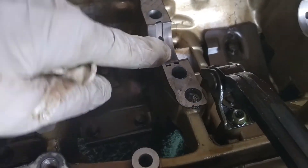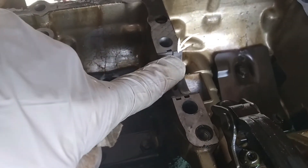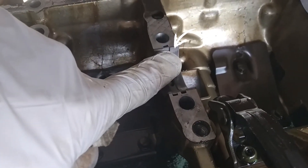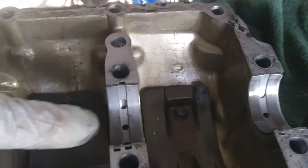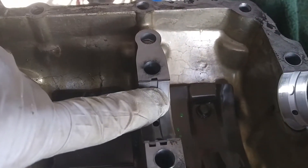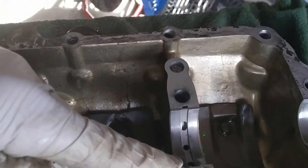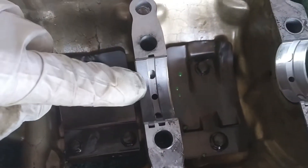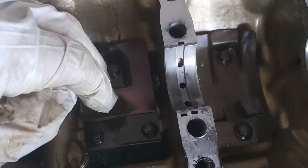Can you see that color up there? This is the bearing. Can you see that color — right there, that kind of color? That's light gray. You can see it here much better. Light gray — this is good. This is what the color is supposed to be for the whole bearing. But now, can you see it becomes dark gray? That means the first layer has been worn.